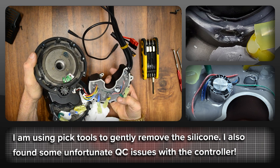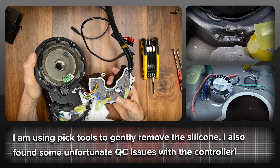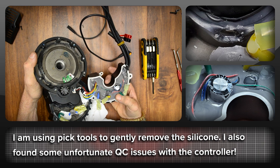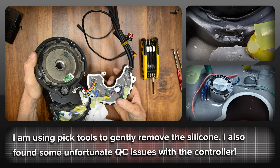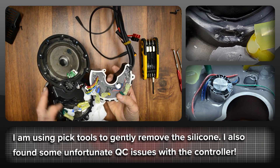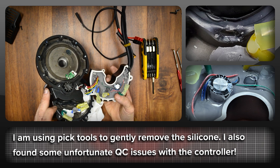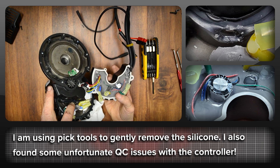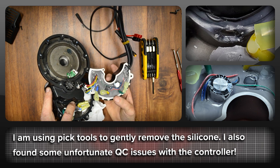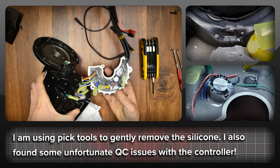I don't know if you can see it from here, but if you look on the inside of the controller where there's a capacitor — this black thing — it looks damaged. It looks like where it's been sticking out, it's been smashed because it's so close to the edge in the potting. It's mashed it and you can see a corresponding damage on the seal where it's just mashed it into the side of the metal. It's actually damaged the capacitor, which is just fantastic quality control.